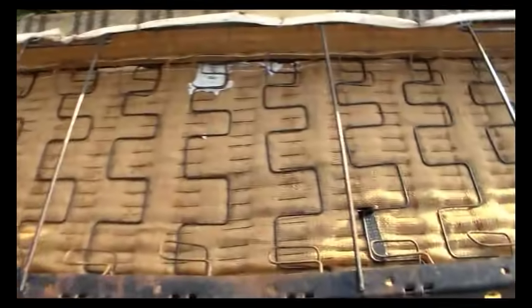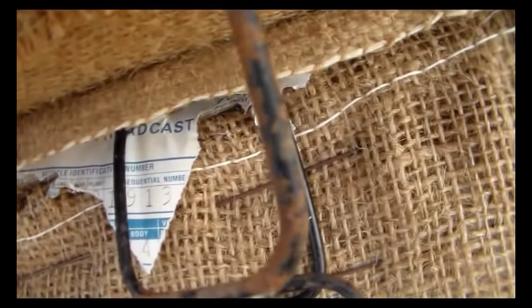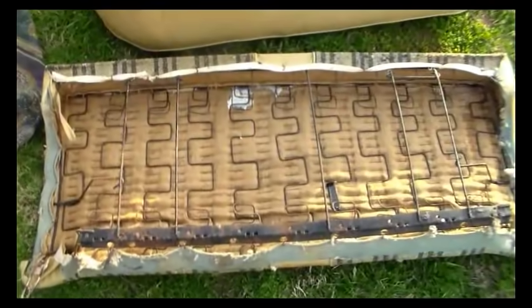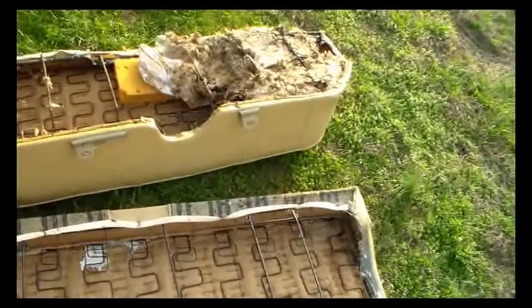Because if we come out here and look, I found the remnant of the build sheet. And we get over to this, and I looked at this sequential number. This one has 1913 on it. I can see B, 1913 is there, and that matches the car's VIN number. So I think these seats are actually the Dodge seats. I don't think they've just been recovered at some point. So I don't know. I'll try to dig that out. Dodge Main usually put one in the back of the seats like that. There may be another one on the bottom cushion, but if it's in there, it's probably destroyed.